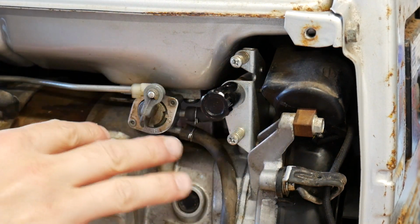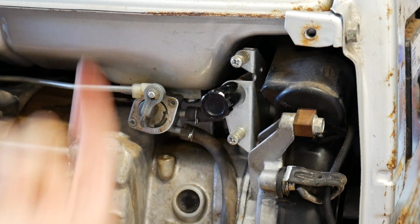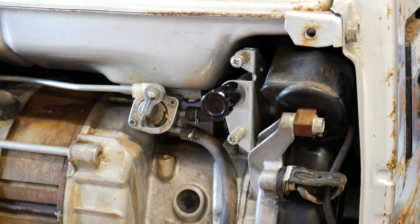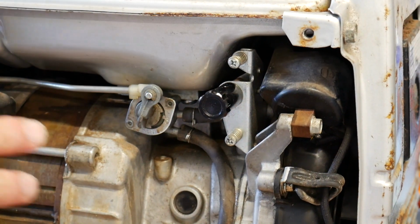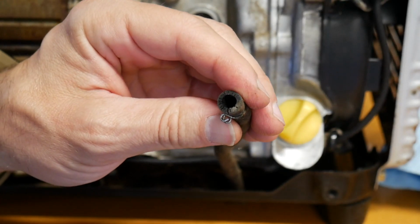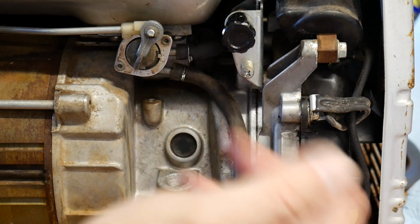A lot of guys with old motorcycles have the same problem. They leak because those screws go right into the tank, and there's nowhere else. It's just gravity, and it drops the fuel right out of there. So they have to seal pretty good, and they have to be soft enough. They just get brittle. Got a couple of those on order. They were like $1 a piece or something. Told you guys, musty one, man. Some crispy stuff going on here. So those will be replaced. That'll be $1 or $2, whatever, really cheap.